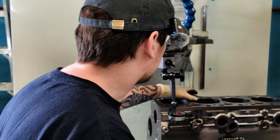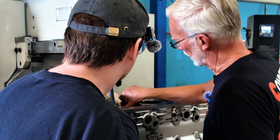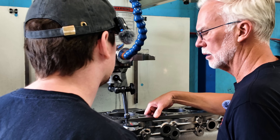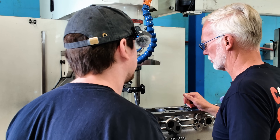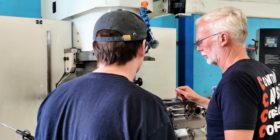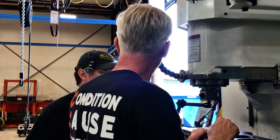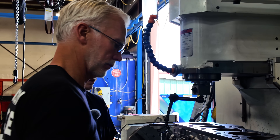This cylinder looks like it had some damage. This is the one that — one of these melted a piston. I think this one had a dropped valve seat and the piston looked all banged up. It was terrible. But the wall actually doesn't look too bad — it looks like it should clean up. So is this standard? You're just going to go 20 over? I'm going to double check it, but it should be standard.